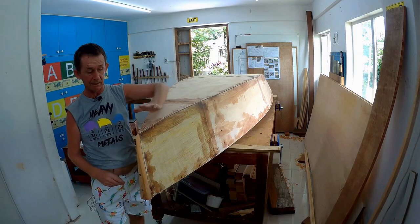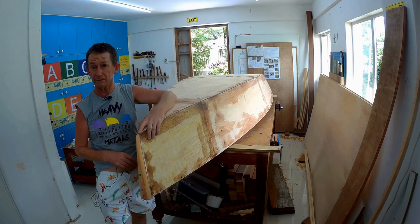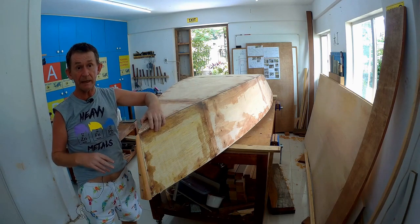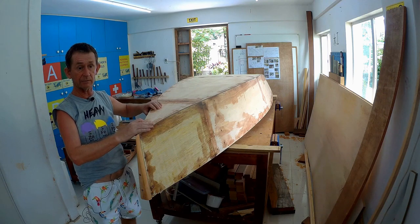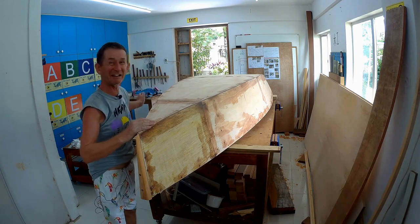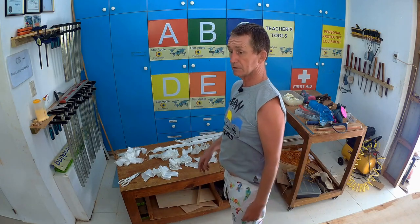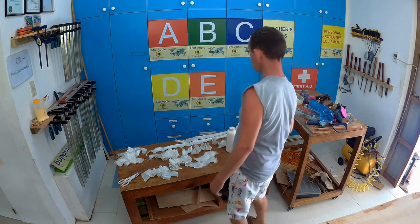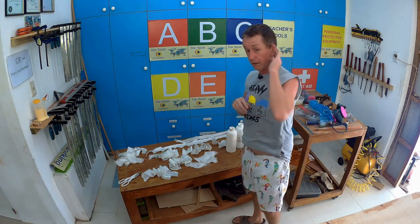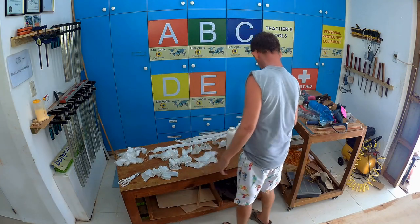So the next job I'm going to do is cover the whole boat in epoxy — the whole outer hull. Then I'm going to put the fiberglass straight onto it, so we're going to work fairly fast. I'm going to use a roller, I think. I've never done this before, like most things I haven't done before. Rex is going to help me mix the stuff. I don't have a clue how much I need, but I'm going to start with 200 milliliters and see how much that covers. I'm not going to show you how we mix it up — I showed you before.